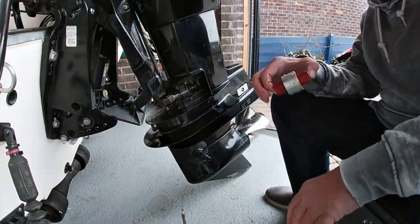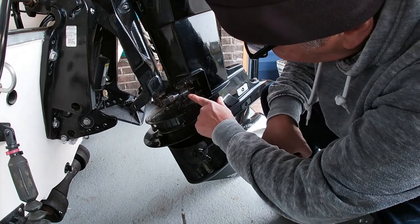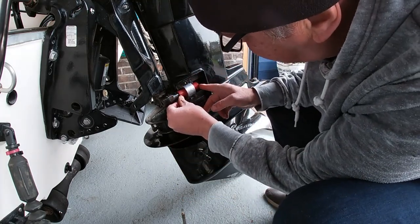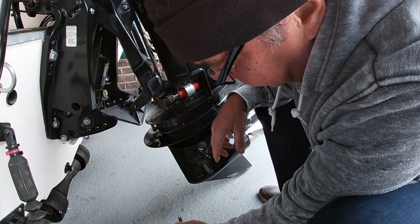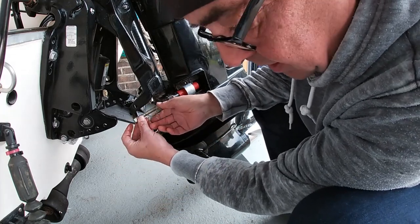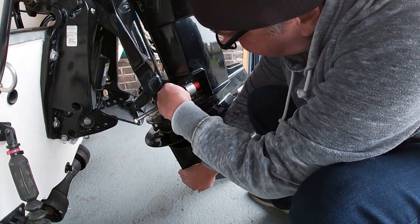We've seen the old one taken out and the comparison with the new one. I've just greased it up with a bit of 24C, and we're all clean in the housing with 24C in there too — all ready to go. We're going to fit the new bush in here — nice and easy, just there. Bolt ready to go, all greased. We've got the earthing strap, so we put the earthing strap in, get the bolt in, then we've got a little spacer here.